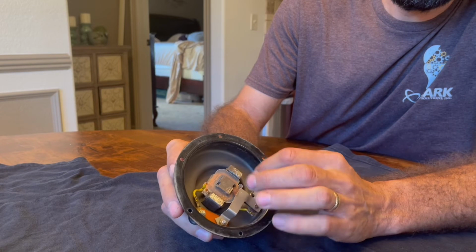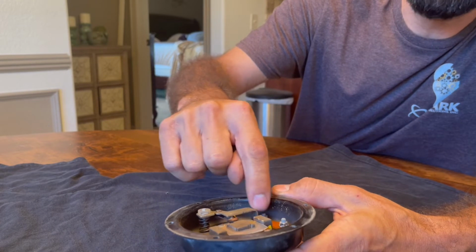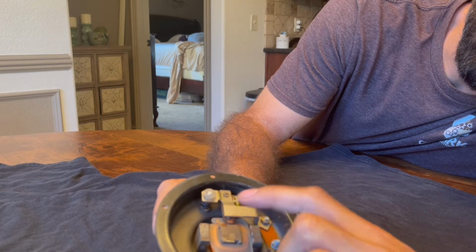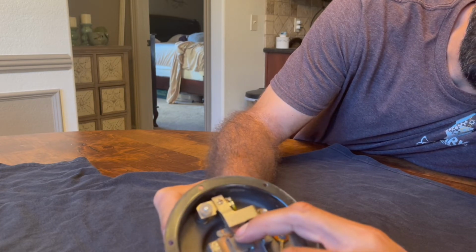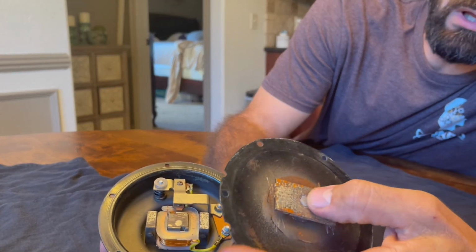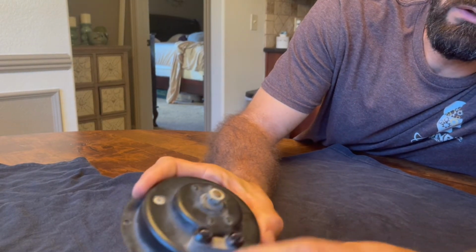You've got your coil here, and the points look a little bit different, but what they do is the same thing. And you'll see this part here is sort of fixed at both ends, very much like the other one was. And it's maybe a little bit harder to see, but right here in between the coil and this upper part here, there's this little tab sticking out, and that tab gets pushed down on by this metal plate. So when the coil is energized and turns into an electromagnet and pulls down on this plate, the edge of the plate is in line to push down on this tab, and when it does that, it breaks continuity between the two points here,